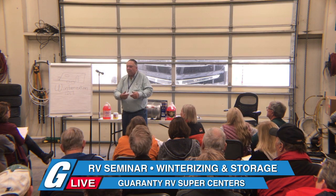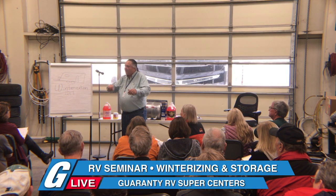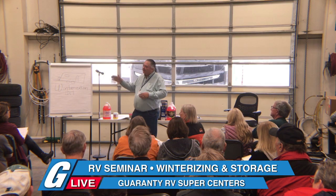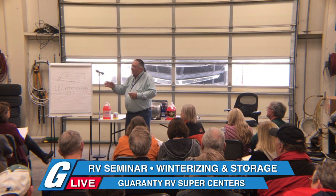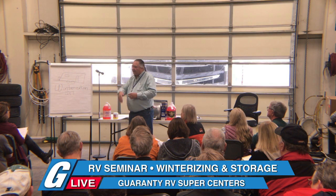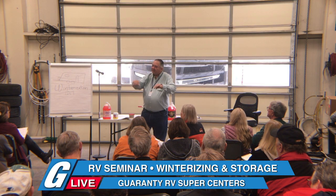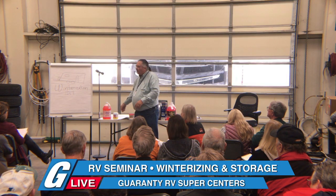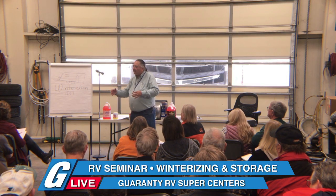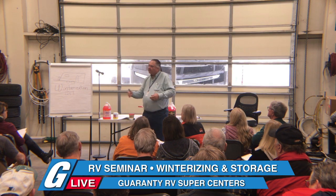Now, you close your low point, and you close the water heater, and go open a couple of faucets, hook your compressed air back up, and you go from faucet to faucet to faucet, always two open, and you just let them run for a few minutes until they're absolutely not spitting any water. So what's gone down the tank, you may have put a gallon down there, but it's going to run out. And then when you're all done, you close all your faucets, you take the stick out of the toilet. At that point, you put a cap on your head, but you don't close your valves. You leave your valves open until the spring.